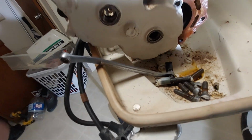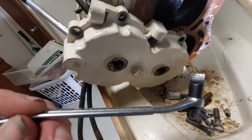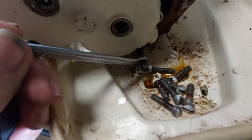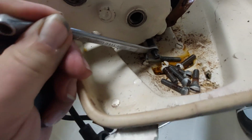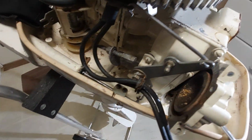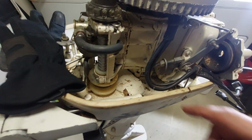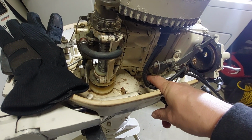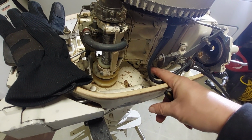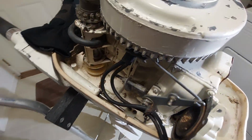What I'm trying to do is I got my hand impact tip in a wrench. And I'm going to try to get that bolt loose. Other than that, I'd have to pull the power head. And I'm not finding a gasket just yet. I didn't look real long and hard, but I'm sure the base gasket isn't going to come loose. If it sticks to one side, you're okay, but most of the time it'll stick half on one side and half on the other, and then it's junk.